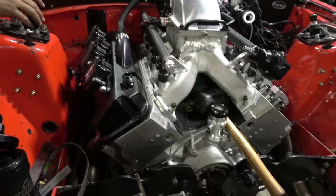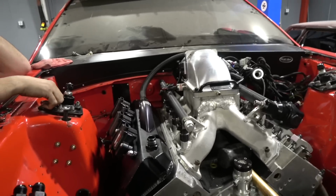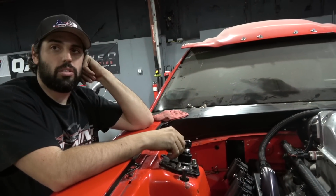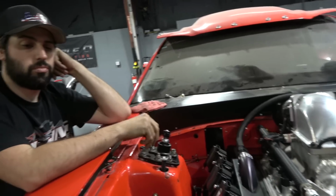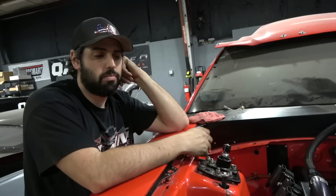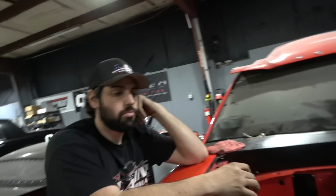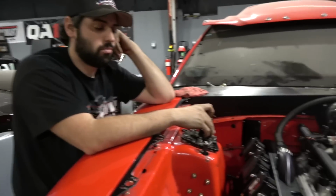Like MK Ultra, the new Bad Apple, I always build them kind of like that. I found something that works good. When you mount the oil filter and all that, you can literally pull the motor out as a unit. The only things that come off are the feed line to the turbo and the fuel line going from the tank to the pump, just a couple lines. Same as the Black Sheep. You could put everything on the engine stand, set the motor in, put the motor plate bolts in, hook your lines up, and you're done. It's ready to go. If you were really racing competitively, you could have a whole backup motor with everything on it and just switch it out.